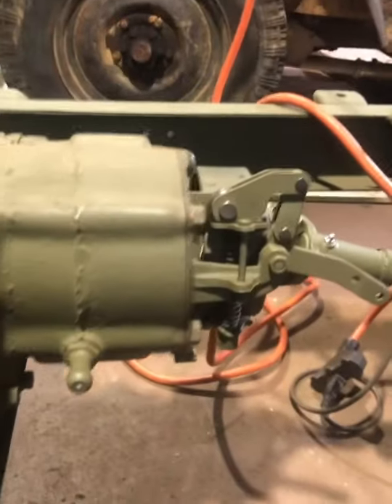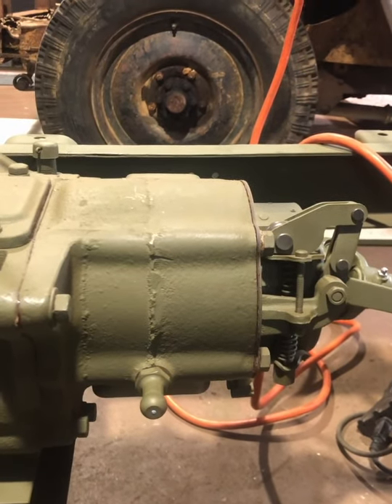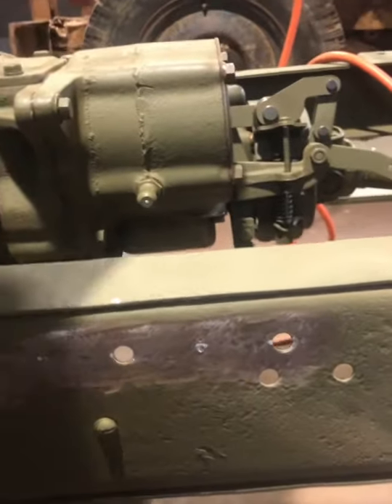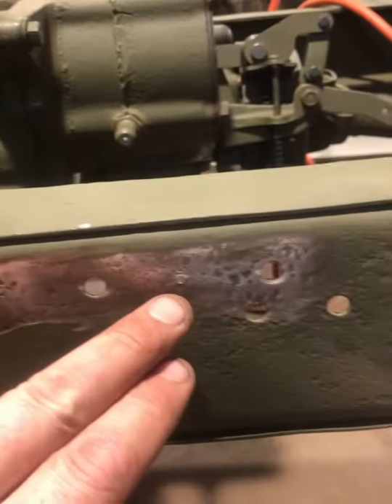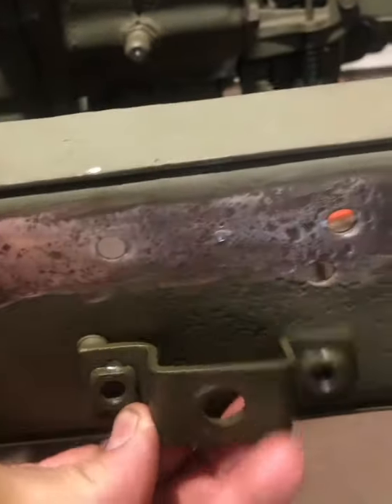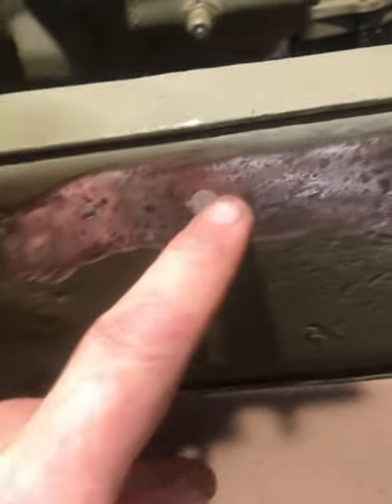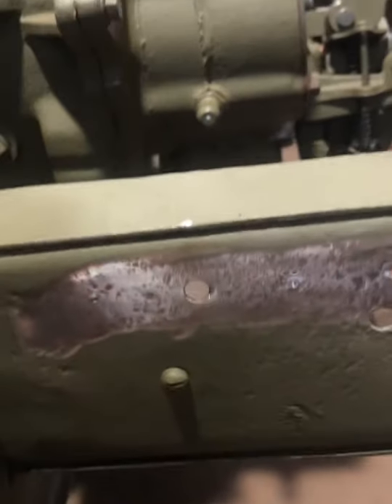As you can see, there is where the clutch control tube mounts on the transfer case. I've put a little white dot in the center and used a framing square to identify exactly where on the frame the centerpiece for the bracket should be. The original bracket holes — let me grab the bracket — the original bracket holes are three and a half centimeters too far back. So I'm going to have to shift this bracket forward. I've already marked those holes and I'm going to drill them out.